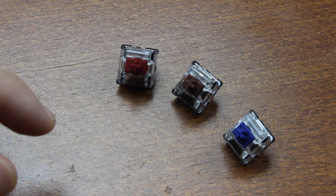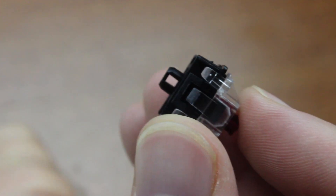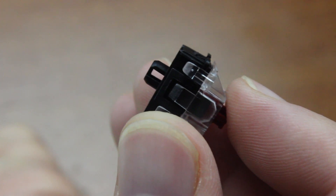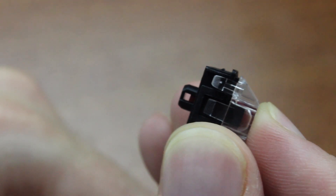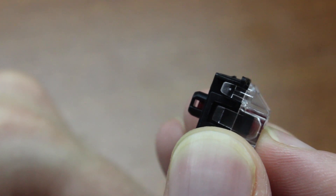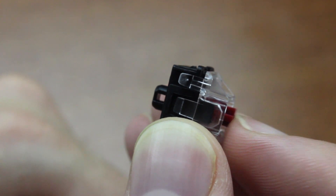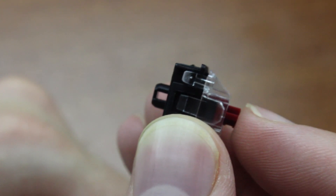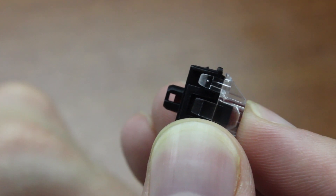There are examples I've covered on previous teardown videos which are extremely ingenious, but none of them are mainstream. The linear version is the simplest — it's just a slider moving on a coil spring which physically interposes itself between the LED and photoresistor in a shutter jutting out the bottom of the switch. Because the optical components are held PCB side, the switch itself is exceedingly simple — just a moving slider that doesn't even directly interact with anything; it's just a light blocker.